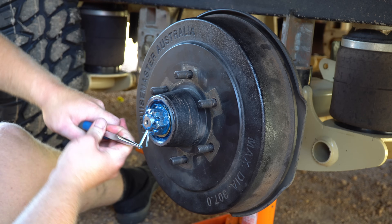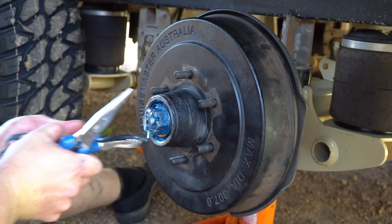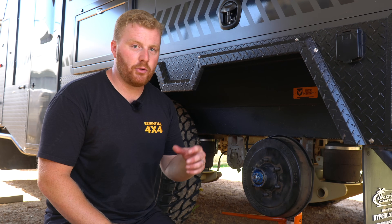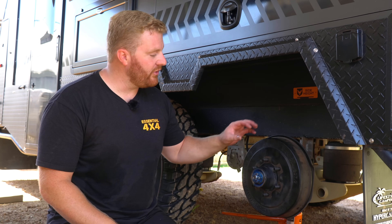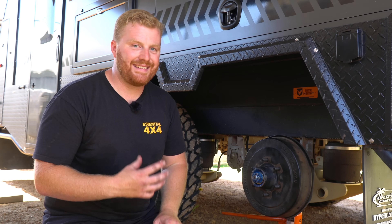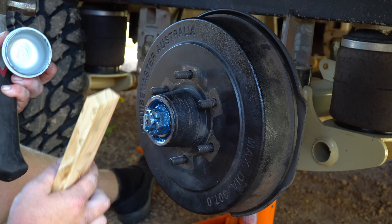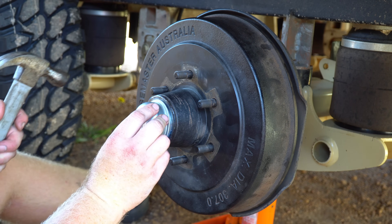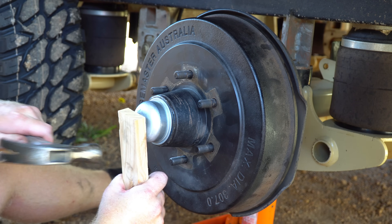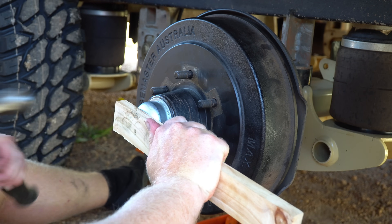There are specialty tools to get that perfect tension on the new bearings, but I don't have them and of course I wouldn't be carrying them on the road anyway, so this is how I go about doing it. I tighten the castle nut gently while spinning the drum — you get to a point where the drum binds up, and then I loosen that nut. Do this a couple of times to ensure that the bearings are seated evenly. Without creating too much tension, you can then align the castle nut with one or two of the cross-drilled holes in the stub axle, where we can reinstall that new split pin from the kit. The tension of a bearing set is referred to as preload or end float. Preload being positive tension placed onto that bearing set, and end float having just a little bit of slack in that bearing assembly. We're trying to get to the most neutral position possible — we don't want too much tension and we don't want any end float. If you are installing a brand new set of bearings, it won't hurt to have the smallest amount of preload as they will wear and seat just a little bit as they start to bed in. But if you're repacking an existing set of hardware, you want to really try and get that as neutral as possible. Once our split pin has been separated and cut to length, grab the new dust cap. Either using a rubber mallet or a piece of wood between a hammer and the cap, gently knock this into place. This dust cap is also an interference fit, so once it's seated, it will remain there until you come to recheck it.